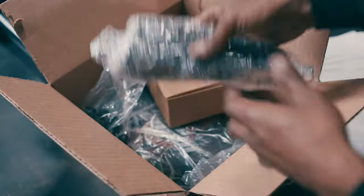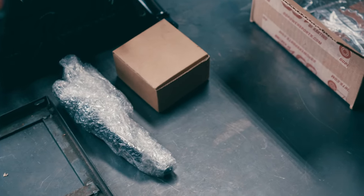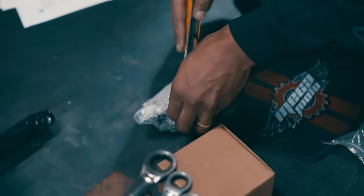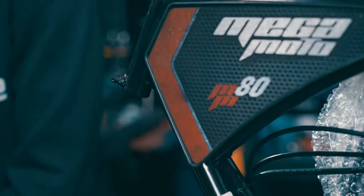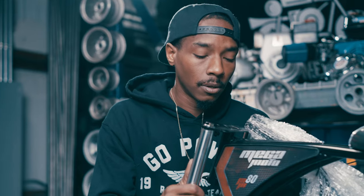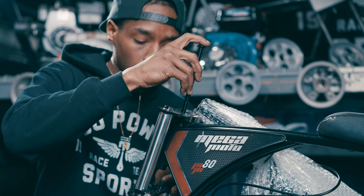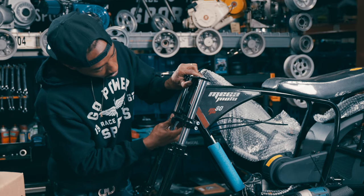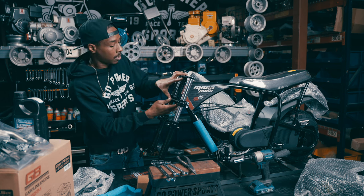Once you get your hardware box open, you'll find inside your hardware kit: your clutch for your bike, your riser kit for your handlebars, and your Mega Moto number plate. I'm going to get my hardware pack open because I'm going to start by putting the forks on the bike. You want your number plate brackets facing to the front of the bike. Match the top hole — this is the pinching bolt and it slides right down. Then your bottom riser plate should slide up, and finger tighten this bolt for now just to hold everything in place.